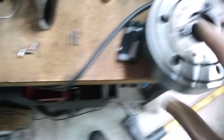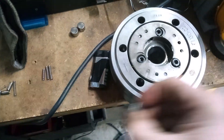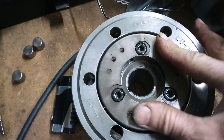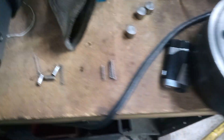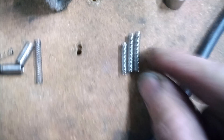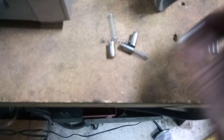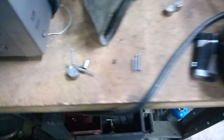Flip it over and it's got the one-way bearing — the starter clutch. It's got these little dogs that go inside little grooves here with these springs and retainers. I noticed these screws are loose holding this on — I don't know if that's part of the problem. There's a spring for each one of these that pushes them into a pocket, and two of them were broken, one of them's okay. I went and got some other springs — these are the holders that the springs slide into, and they push against these to hold them into the pocket.